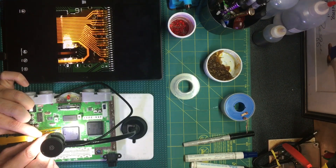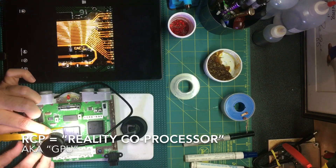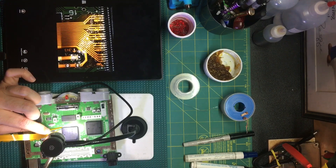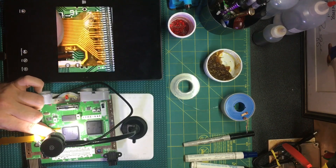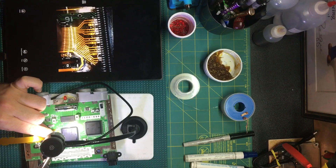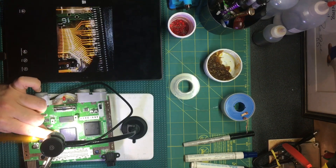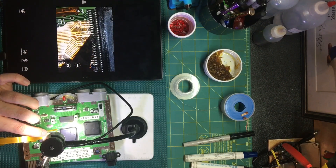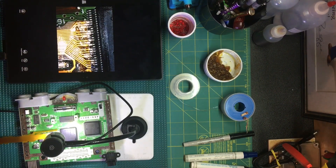I've already flexed onto the graphics chip here — the RCP of the N64 — that was from a false start for this video. I'm trying to line it up with pin 6; you can see a little dot there that's for pin 5. You can also see thicker traces down there for the shared ground that runs on the underside of the flex. I like to aim for those when tacking it down — maybe they hold a bit more solder — and it helps me distribute it.